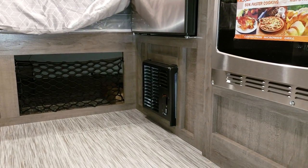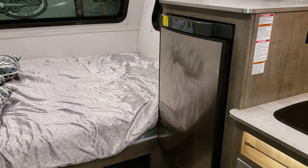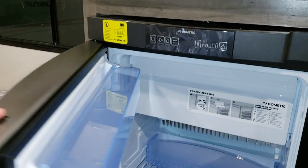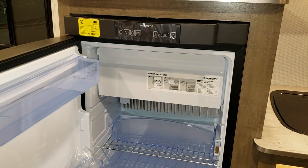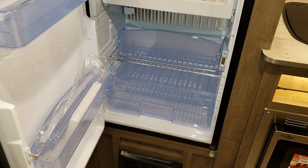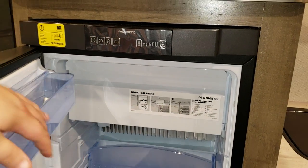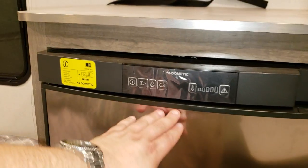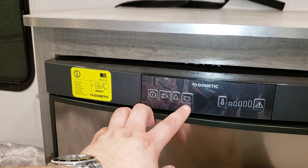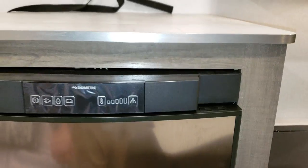On the right-hand side is the furnace and a three-way refrigerator. This is a true three-way refrigerator — gas, electric, and 12-volt. A lot of brands have a similar-looking fridge but only two-way, meaning it does not work off the 12-volt battery system. The freezer part can actually be removed to make the fridge a little larger. Controls include a power button, electric button, gas button, battery button, temperature control, and a little push button to open the refrigerator door.